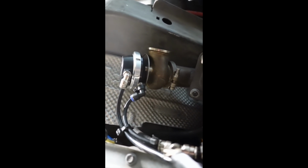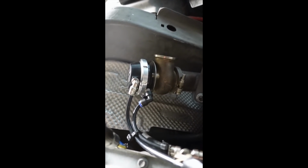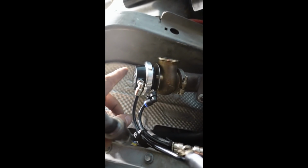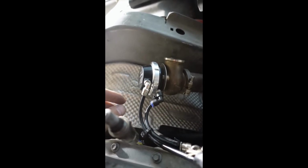Wasn't even tightening it that tight, but it snapped in there. And so obviously no one locally has a 1/16 inch NPT tap. So what I did was just tap it for 1/8 inch NPT, the correct size of all the fittings we have, and it works just fine.